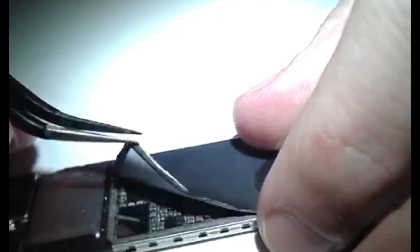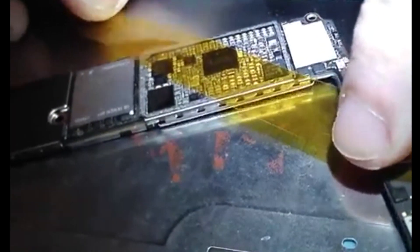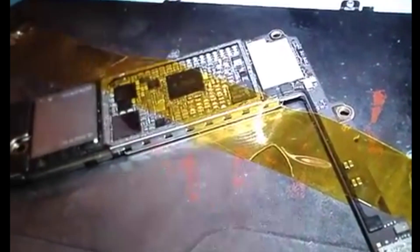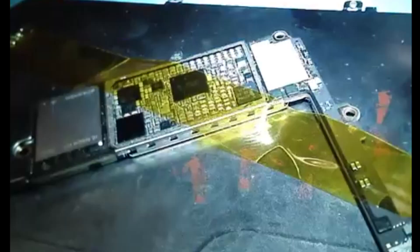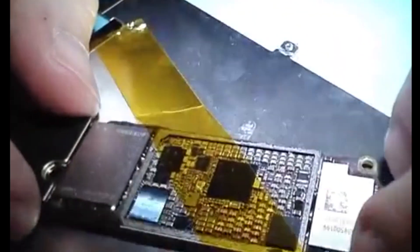If you're doing this on a 6 Plus, they actually make a shield that will help the flexion issues. Next, we're going to put this board on an iPhone 6 — it's actually the mid-frame for an iPhone 6 Plus, which goes on the back of the LCD screen. We use this instead of a board holder just because it has less thermal mass. A large issue with these 7s is that when you go heating them up, things tend to fall off the other side of the board because of the immense heat required by this audio IC.